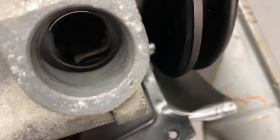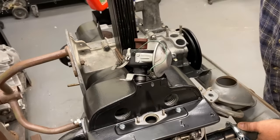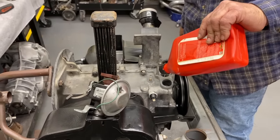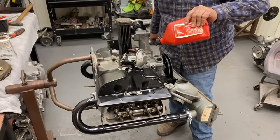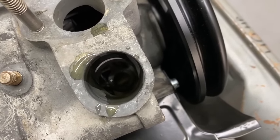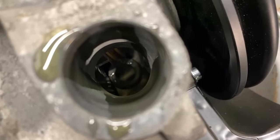First, we're gonna take some oil, and we're gonna put some oil down in this hole. And the other thing we're gonna do first is we're gonna orientate this where the hole is flat, like so. Gotcha. Okay. Now we're gonna put a little oil in. And I know you guys are thinking, man, it's much easier to put it in as you're building the motor. Right. It's just the way you know how to do it. It's just a little more comfortable for me to do it this way. But I suggest whatever is the most comfortable for you is how you should put it in. And if you're beginning and you have never done this before, it would probably be a smarter idea to do it the other way and assemble it in the case first. Gotcha. Yeah.